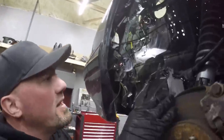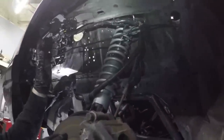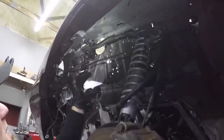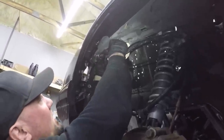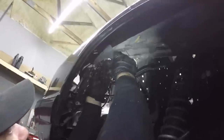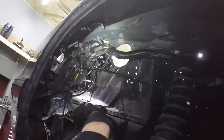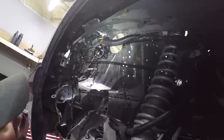Status update: just kind of making some of the connections here, getting them all tucked up again. This is not rocket science and there's no right way to do it — you just try to get it all hidden and up high enough that it's going to be inside the fender well. Like right here your headlight harness is close — it'll plug in but it's tight. We're just going to start hooking everything back to the solenoid and making our grounds on the backside.